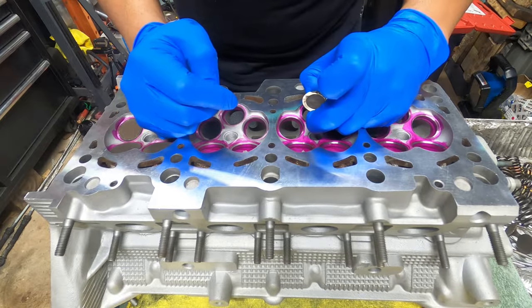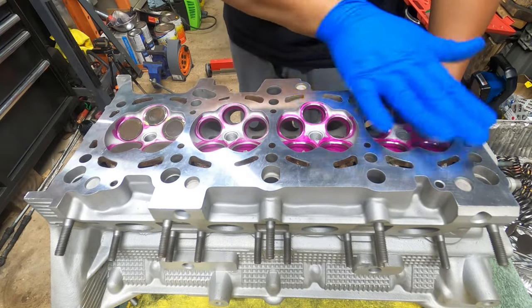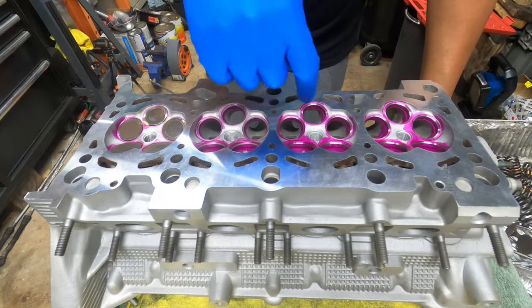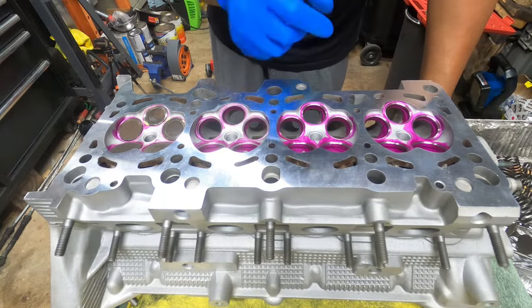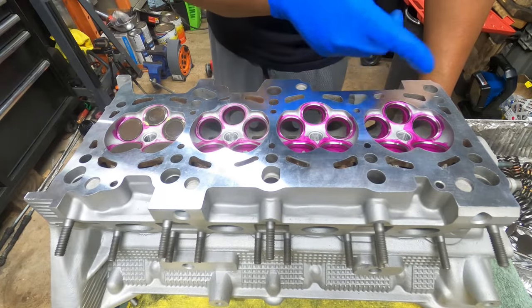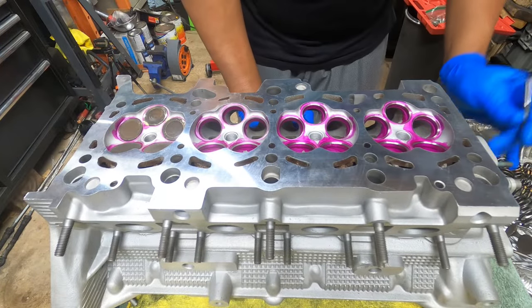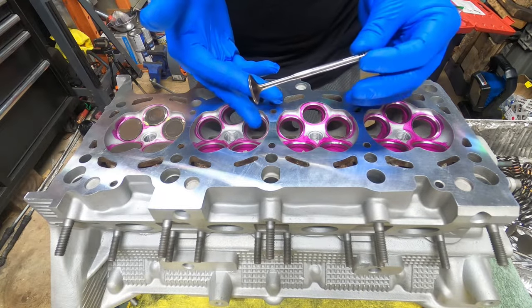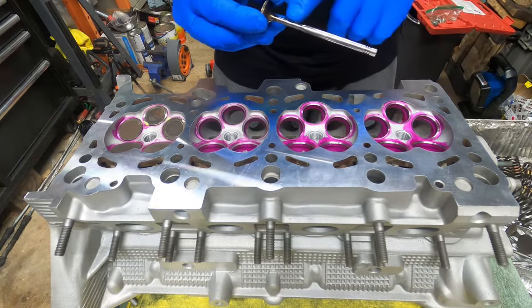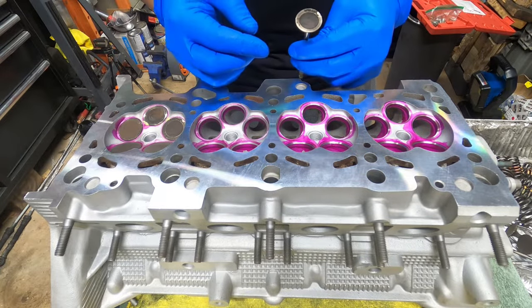In these two cylinders I have the original valve stems — I have new ones going in, but I use the old ones so when I slide them in, I can grind them and it keeps them there without moving, helping guide them in and out a little bit easier. You can have all the valve stem seals removed if you want — not 100% necessary. The first part of the procedure is to grab one of your original valves and coat the stem itself with a tiny bit of oil so that it spins as freely as possible during the grinding procedure.